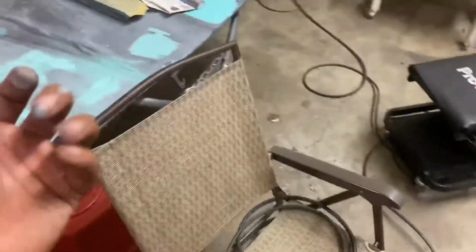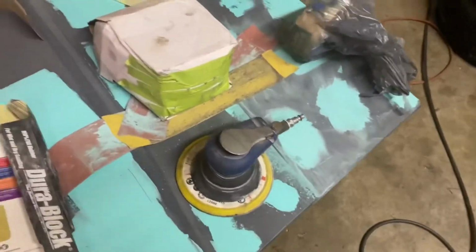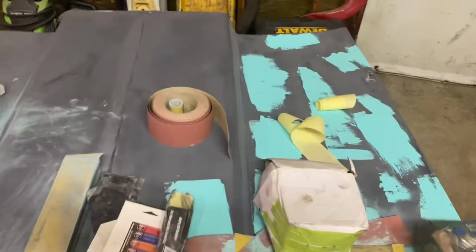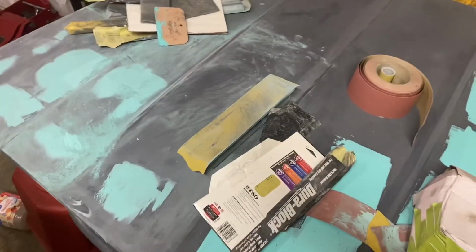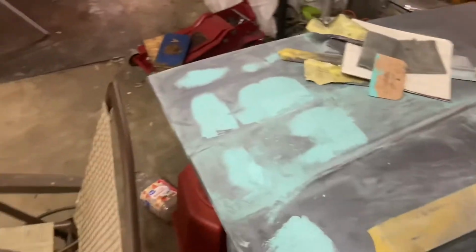But once I do that, by the time I block on it, I get to the point where in some spots it's starting to pull the primer and the fiberglass hairs back out. So I'm probably about to get to a point where I just say, forget it, get the DA, run over everything till it's smooth and call it done for now. I'll buy a real cowl induction steel hood in the future, but I just need to finish this hood, spray it, shoot it, and then I might spray a coat or two on those mirrors, maybe that pocket because it's with the trunk,